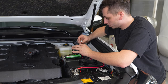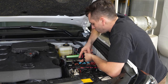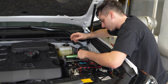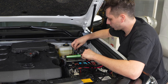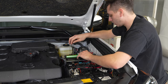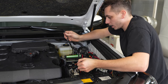Now we can just plug in the harness for the switch panel and feed that up through the slot and into the fuse box. This is a little bit more difficult because these slots aren't perfectly lined up — that's one of the things we need to change. I'm not even sure if the plug for this is actually going to fit in this situation — which it will not. In order to fully test this out I'll have to wait until we get the revised version. For now I'll just plug it in without the cover. This would plug in here, run through the slot like the power and ground wire, then run through the firewall and hook up the switch panel on the dash.